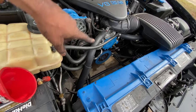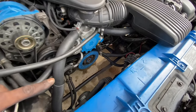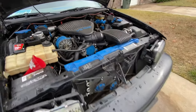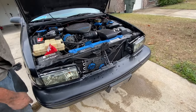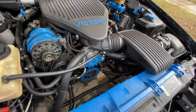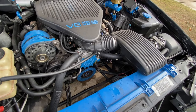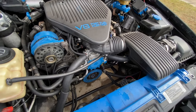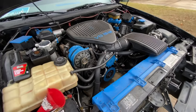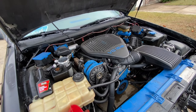Watch your gearbox. Watch the bottom of it. You'll see it dripping from right there. I see it. I've been seeing it since it's been jacked up. I had to put the cardboard down there at first, but I think the wind moved it. What is that leaking out of there? It's power steering fluid. Your gearbox, the line's going through the gearbox. Once we put it in the lines, we'll see where else it's dripping. I was thinking it was doing that because of how it was jacked. So that's one of the leaks for sure.